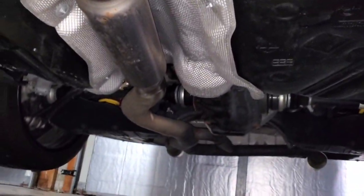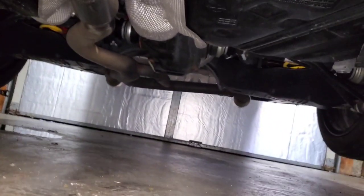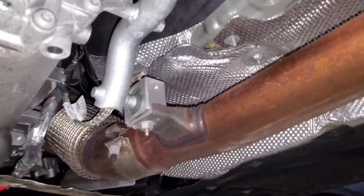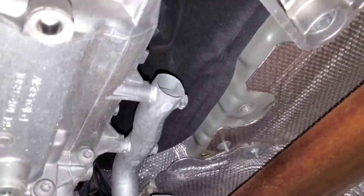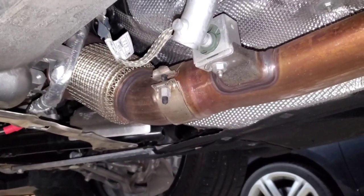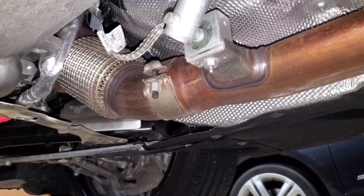These six bolts on the main bracket are T50s; the ones in the very back are T60s, so I was only able to get those with a half-inch drive — you'll need an adapter if you're using a 3/8 inch socket wrench, or a big half-inch drive breaker bar. I have a stock mid-pipe and a custom muffler delete, so follow your exhaust setup for removal. I'll remove the two hangers by the exhaust tips, then come up front, remove the screw from the bracket at the transmission, and remove the exhaust clamp.